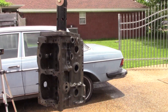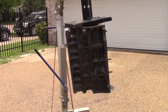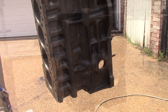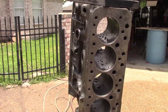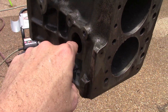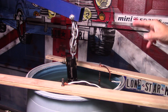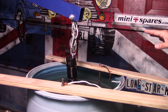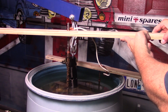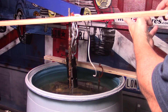That is the first — or really the second cleaning; the vinegar was the first, this electrolysis was the second. And my gosh, it's looking fantastic by comparison to what it was. I still see some garbage in there, but not much. This is day two — the block has been soaking for another 12 hours or so. I've unplugged the power and taken everything away, and now I'm going to lift this up and look at all the garbage that's on the sacrificial piece.